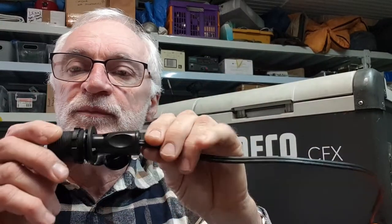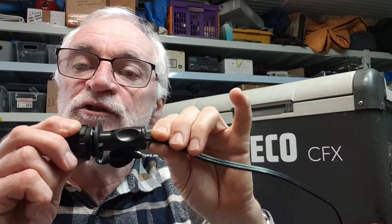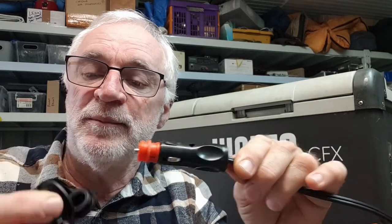There's another issue too — this is a terrible connector. It moves and wiggles itself out on bad roads, or even any roads. Just vibration, anything pulling on it, and this thing can just come out. It's very easy for it to disconnect from the little flat contact point inside the panel. You'd be surprised — that's probably half the problems I see.